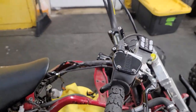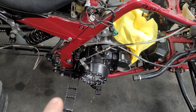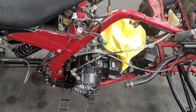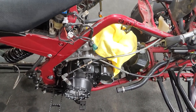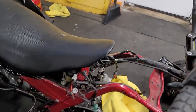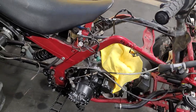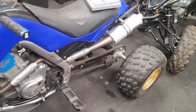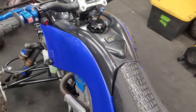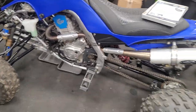That is what we have for today - I hope that explains a lot. The extended arms on the motor that we talked about, why we say not to use them - those are changing the ratio down on the engine side. Same deal as the reduced ratio up here at the lever - now you have a reduced ratio down there too. The combination of both is very bad, and just doing one is bad. So back to the finger workouts - figure that out, or get yourself a Can-Am with no clutch lever.